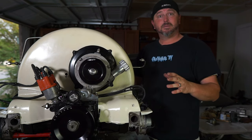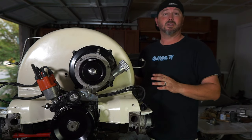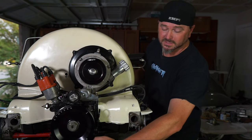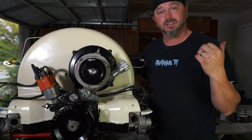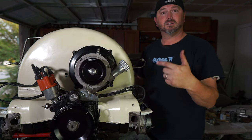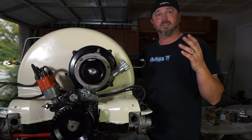That's going to be next week. The next time you see this it's going to be fully built and put together — you guys have seen me do it a million times, I'm not going to make you watch it again. But we will go through the tuning process and the priming process to make sure we get oil into that pump. We're just going to loop it for now — I'm not going to attach all that stuff to fire it off — so the oil just goes right back in. Hopefully we can pull that motor out, stab this one in there, and just start driving the bus. I'm really excited — we're almost there.